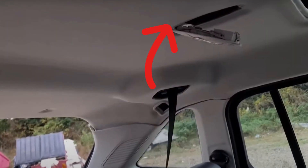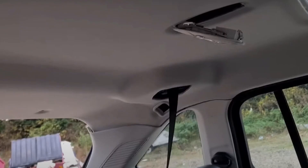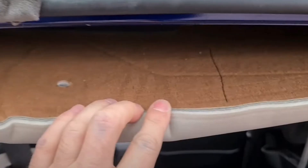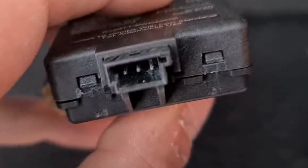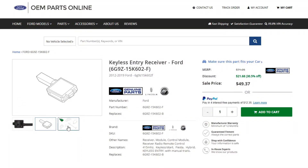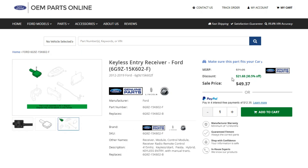Given the fuses are okay and the fob is working well, focus on the main possible culprits. Starting with the receiver or antenna — this module is located above the headliner in the rear part of your car and it's a pain to get to. If you've got a sunroof, this is most likely the reason for the problem, since even the slightest leaks will gradually corrode the receiver's contacts. The module itself is not that expensive; you can get a used one on eBay for a fraction of the price, and these antennas are plug and play — you just need to find one compatible with your car.